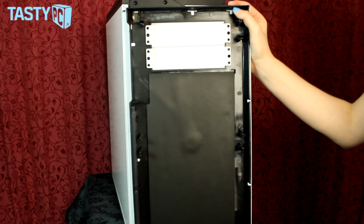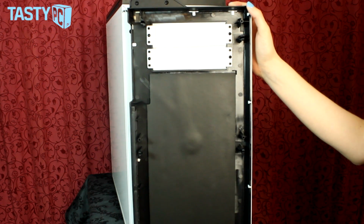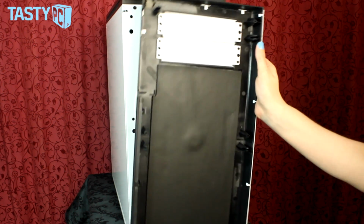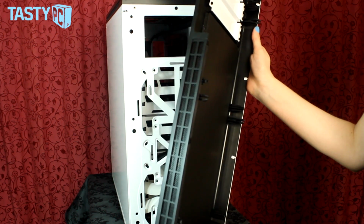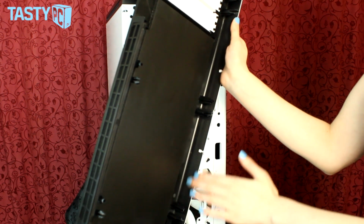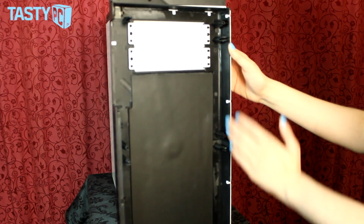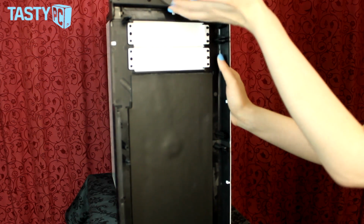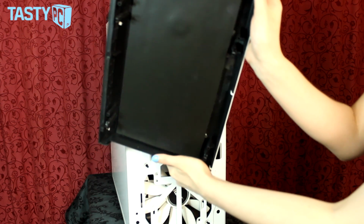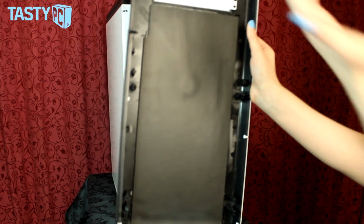And you can see the two 5.25-inch optical bays and the screws that hold the covers in place. Now, like I showed you a second ago, to keep with NZXT's quirky design, they've only put ventilation down one side, which is fine if you put sound dampening material in the places that haven't been used for airflow, but NZXT haven't, meaning this side here, the bottom and the top, have pretty much only been designed for looks, because they could quite easily have put ventilation or sound dampening material there or here or at the top.